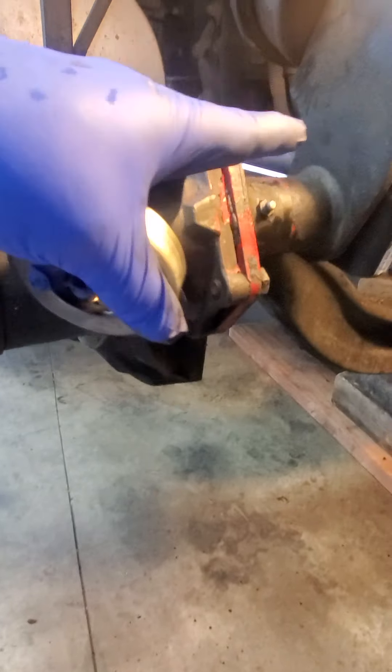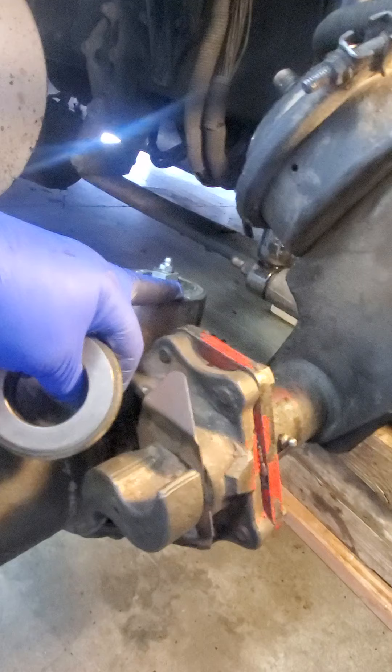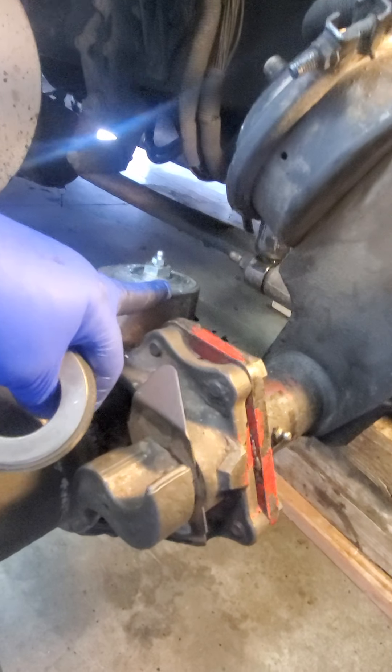So while the bottle jack was down there and it sat overnight, when I came back the next day in desperation mode, I was hitting the top of this with a sledgehammer. Wrong - don't do that. I must have dented the top. So when I went to go thread the new lube plate in there with the grease fitting, it would not thread. I tried everything - I went to Advance Auto to see if I could get a re-thread kit, they had nothing. I tried filing it, tried wire brushing it, took a little grinder to it, and it would not thread down.